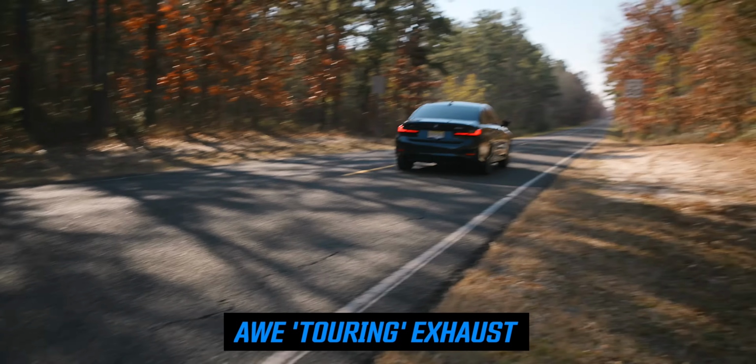You're going to look for the dimple on both the 4 Series and the 3 Series, cut it there, you're going to install this exact same piece, and then instead of installing the muffler section, you're going to install this pipe, which as you can see is basically a straight pipe, and it deletes the mufflers and it's going to give you a lot more volume.